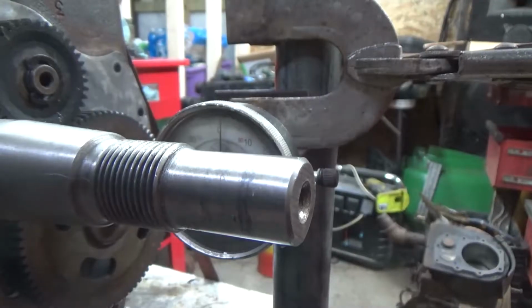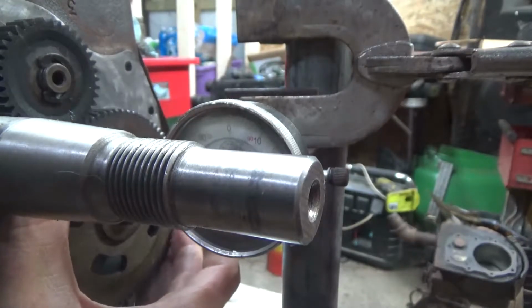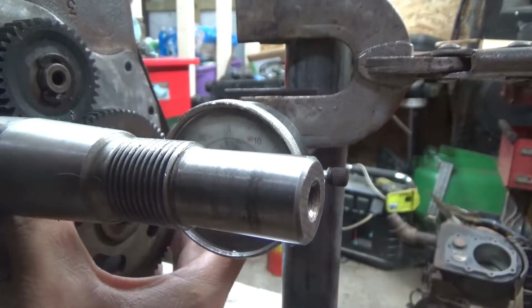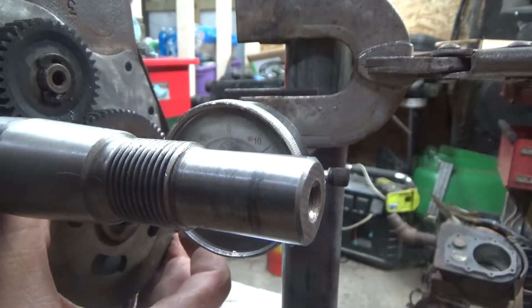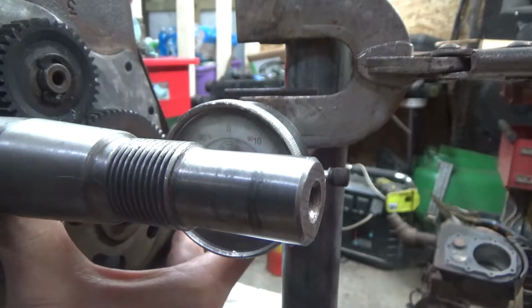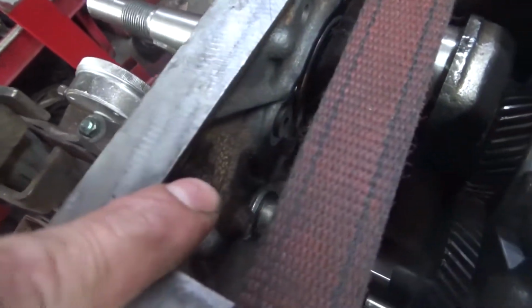Alright, let me set up for the next one. That needle's sitting really close to zero, and my gauge is reading about 10. Eight. Yeah, let me get a feeler gauge, and let me go down and check the crank end play.